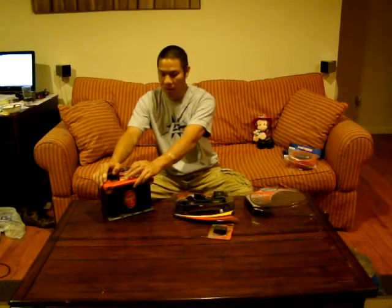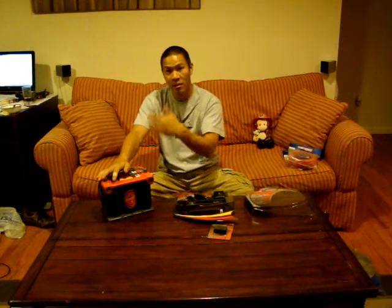So if you have any questions, remember, you start from a battery. You've got to get a good battery. It has to be strong enough to run the system. Cold cranking amps, you can do the math, add it together, make sure it's correct. Then you have power wire. You've got to get good power wire. Cheap power wire is cheap, good power wire is good. If there's more jacket than wire, it's probably pretty cheap. So make sure the jacket is kept to a minimum and the wire is kept to a maximum.